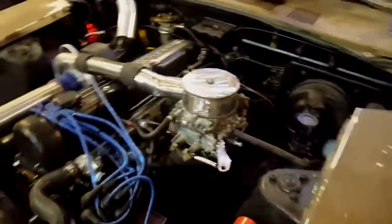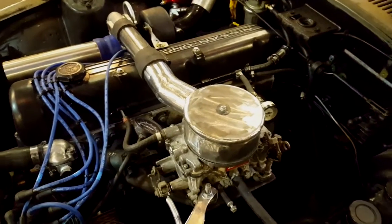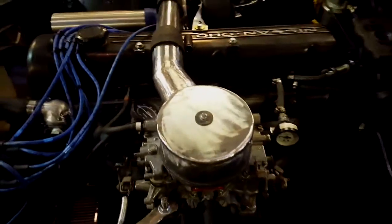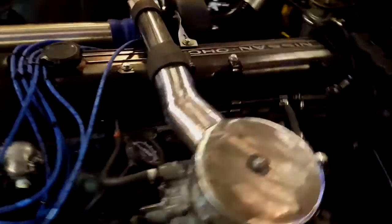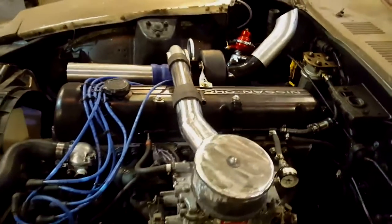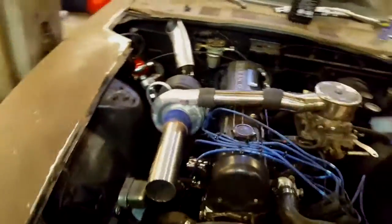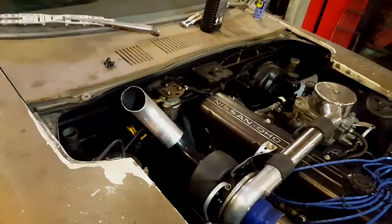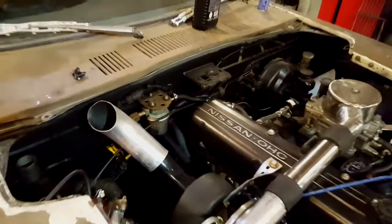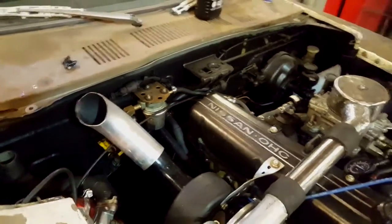I built the carb hat myself — built it today, bolted it on, fits nice and sealed up good. I had to make a little angle to clear the pipe. There'll be a breather hose that comes off here to a remote filter. The fuel tank was a pain — we removed it, it was all rusty, fixed that up, removed the stock fuel pump, and put this Carter fuel pump in. I can look up the part number if you're interested.